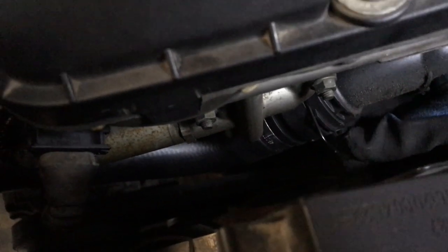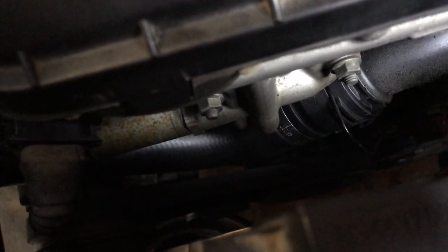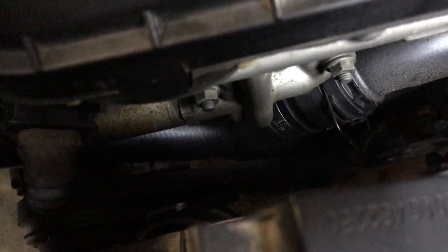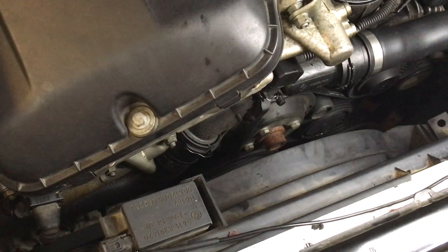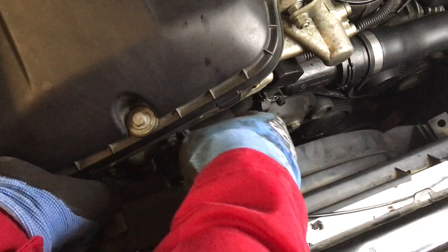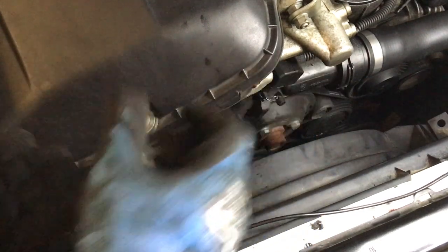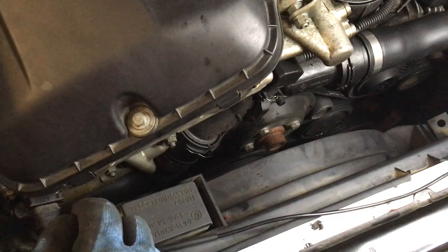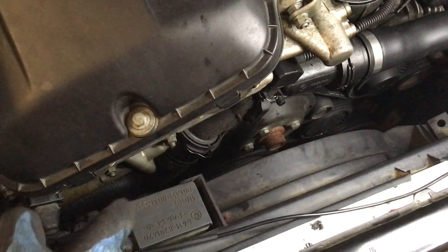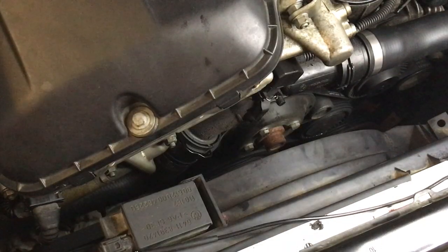Once it's unlocked and you line it up, it should be fairly easy because the hose is contoured and that shape gives you enough force pushing it forward into the thermostat housing. Press from the bottom, try to reach under. For the top part of the quick disconnect hose, use both hands — one hand on the middle section of the hose and one hand where the quick disconnect is, then press up evenly and it goes right in. Remember to wet that inner O-ring with coolant. Pull up and it'll click right in. Make sure the pin is open when putting it in, then close it when it's fully seated.